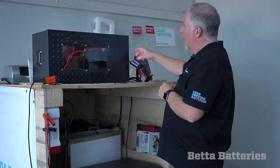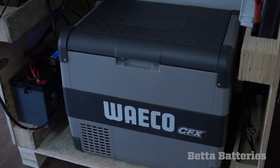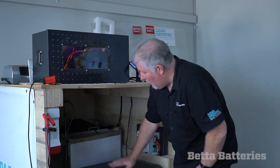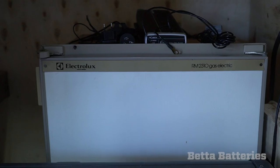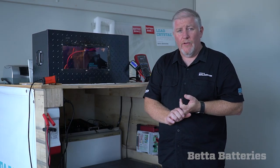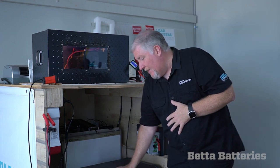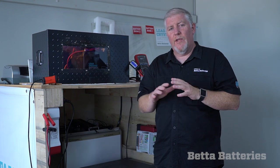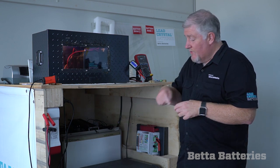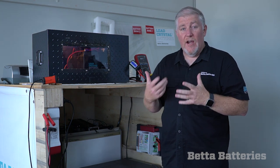Running out of the second battery — our lead crystal — we're powering two fridges. A CFX Waeco 65 that draws about 5 amps; every now and then I open the lid so it cycles. Behind it is a three-way fridge from a caravan, running on DC mode. Three-way fridges run from gas, 240 volt, or 12 volt, and this one is set to run on 12 volt, drawing about 11 amps. Interestingly, the Waeco has a low-voltage disconnect at about 11.5 volts to protect the battery, but a typical caravan three-way fridge doesn't. On the 12-volt setting it has a small heater element that basically boils a little ammonia — a constant current draw that just keeps going.